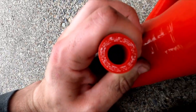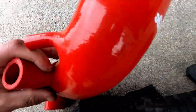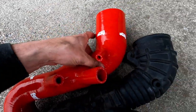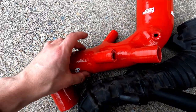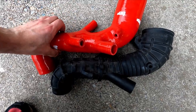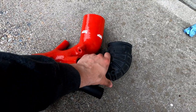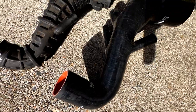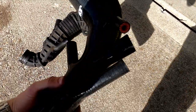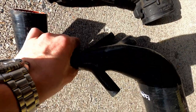It's also made of a thicker ply silicone, which makes it less likely to collapse under a high air intake rate. There are a ton of horror stories online of the OEM turbo inlet pipe closing due to high pressure. If your engine is tuned, it's going to take in a lot more air than the car normally would. If your air intake can't quite meet this demand, the weakest link is actually going to be your turbo inlet pipe, which causes the OEM one to collapse up near the neck where the material is the thinnest — kind of like when you get the end of a plastic straw stuck on a piece of fruit in a smoothie. For how cheap my buddy found the eBay special, I'm honestly really impressed with the quality.